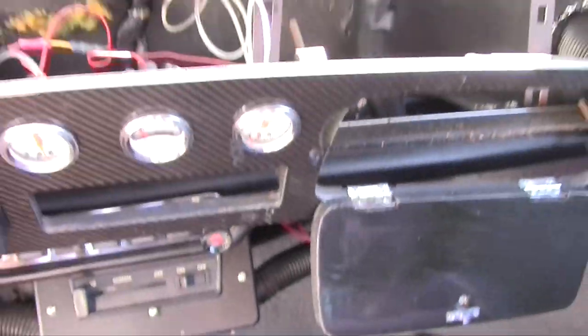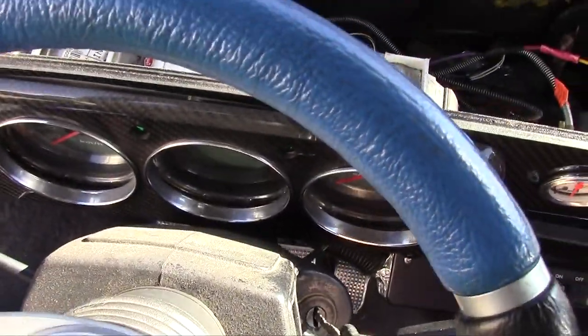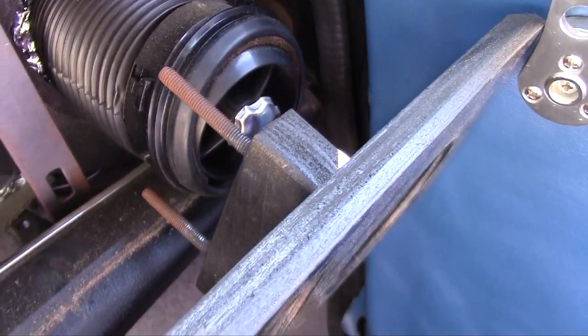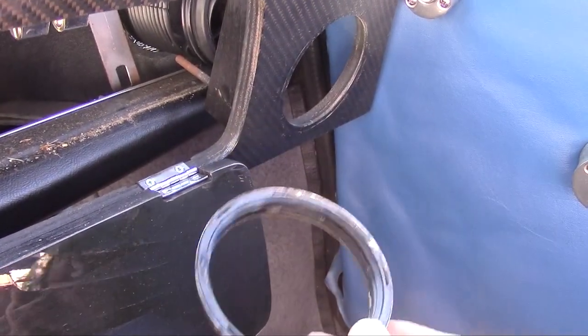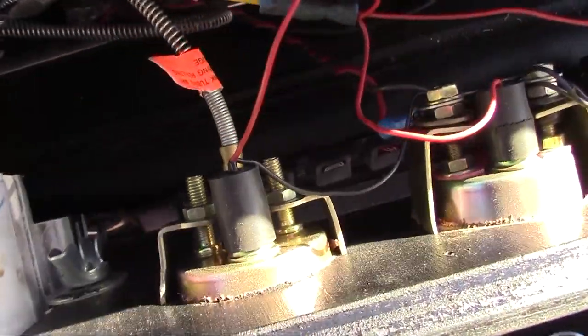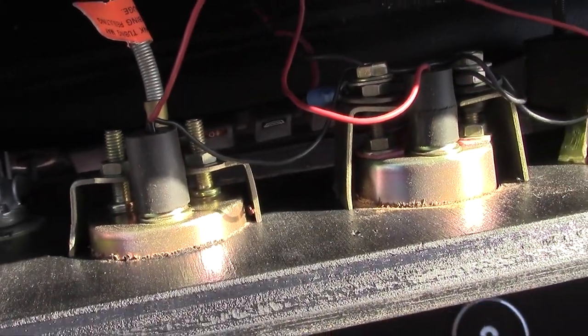I have the dashboard loosened and right now it's just leaning. I'm not going to pull it out entirely, but it was fairly simple. There were six studs — two on the left-hand side, two near the center, and two on the right-hand side. I did have to remove the bezel to the vent because that was holding it on. I removed the two bezels and this thing just slid right out. Now here's my temp sensor, and I can see the back of it right here.